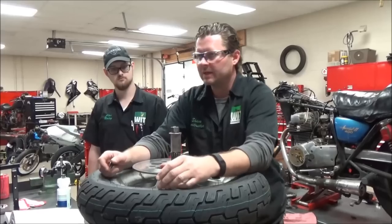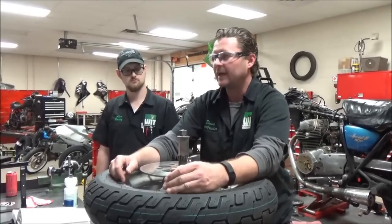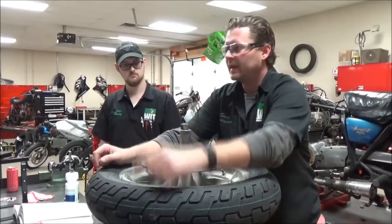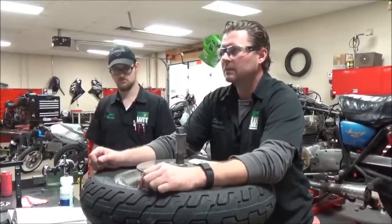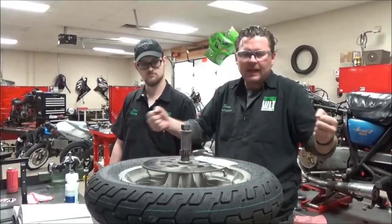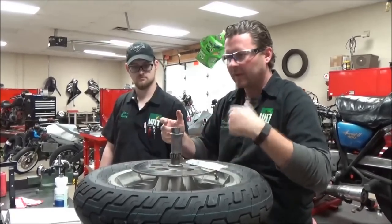Your bosses are not going to want you pulling off every brake caliper and chain to check this — you have to develop a feel for the drag with the brakes and chain attached. But on this one, if it's that tight at 10 foot-pounds and you torque it to 65 foot-pounds, with the bike weighing 700 pounds, would it roll down the road? Do you realize how many people wouldn't notice? The bike's heavy anyway, so you add a little muscle — is the bike heavy or are the bearings crushed? You want to check this. Don't take for granted that anything clamped like that needs to rotate freely.